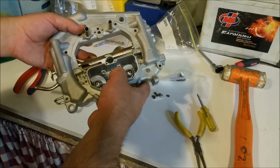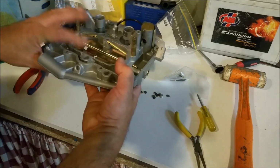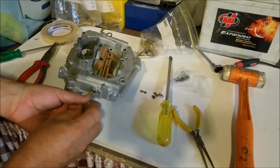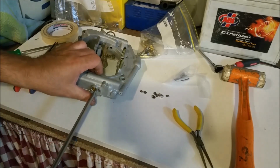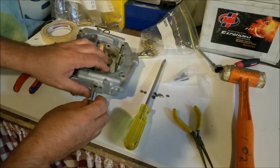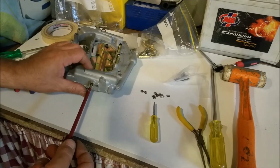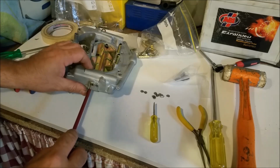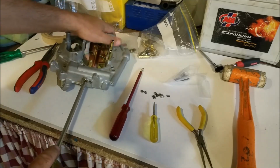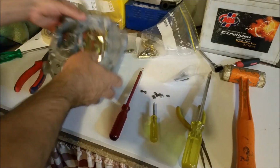And that, when it opens, that sort of shows the drawing effect on the secondary spray bars. So you're going to get a big sort of vacuum in there. And there's an adjustment we do in that we turn this tight seat thing another quarter turn. So I'm just going to create a little bit more drag there, just so it stays where I want it to. So it's stopped. So we'll go a half, 1, a quarter, and then we tighten this up. And it should be the right tension.